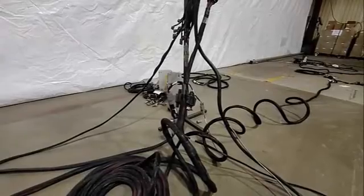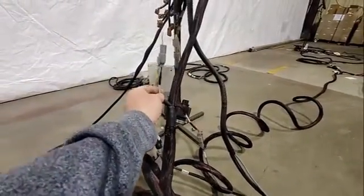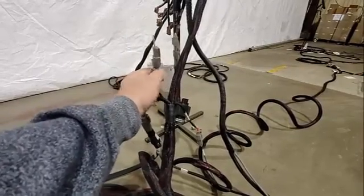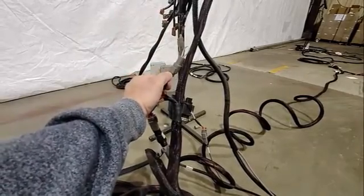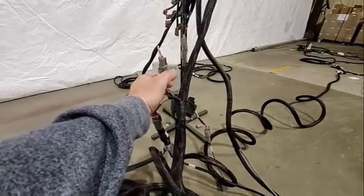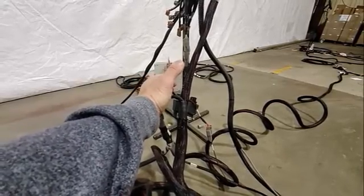Also at this connection, with our safety switch — that was the wire with the loop cap — that loop cap needs to be on that safety switch, as it allows us to remove this cap while working on the machine. This will allow us to safely work on the machine, leaving everything powered up and being able to test under load without actually being able to use any of the functions.